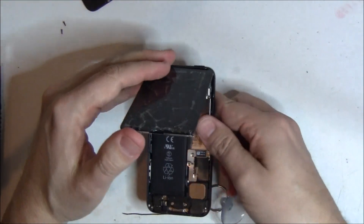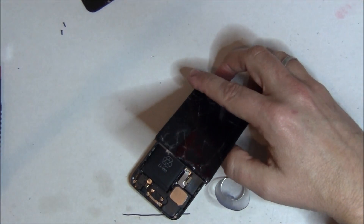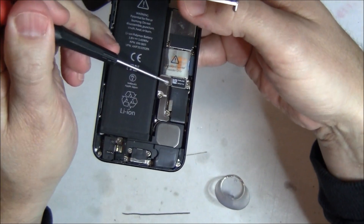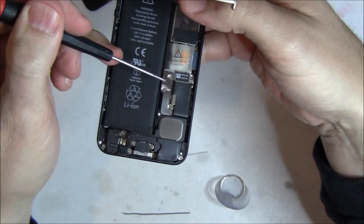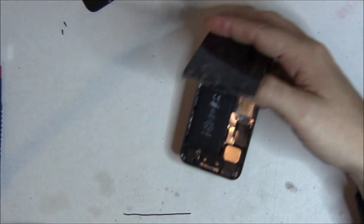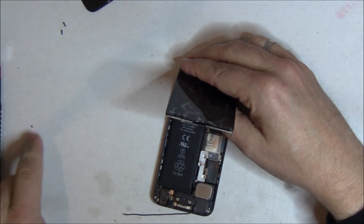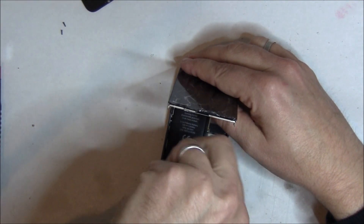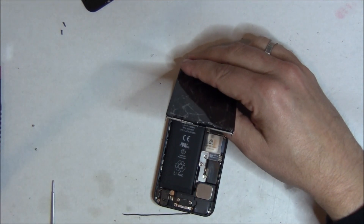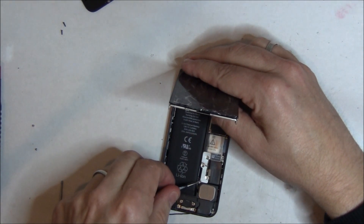Here's the inside of the iPhone 5. One of the main differences between this and the 3GS is the 3GS, you can just pop off the three cables up top. In this case, we should disconnect the battery first, like the iPhone 4. There are two screws there that cover a shield holding down the battery. We're going to take those screws off and disconnect the battery so we don't shock anything when we work on it. That EMI shield just lifts straight off — a pair of tweezers will get it off. These are ESD-safe tweezers, so I don't create any static inside the phone.